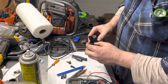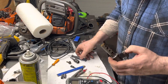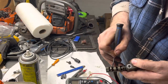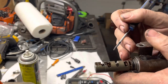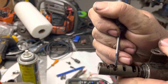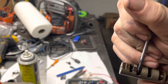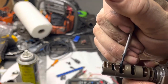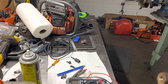The other one tested out fine too. After prodding around in here a little bit, this is kind of how these things work: there are valves in here that move, based on a spring that returns it, and then the oil pressure would overcome that spring when it wants to change the timing. That's basically how that actuator works.